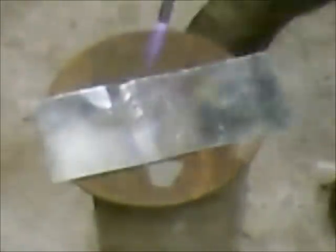We're going to heat this until it turns silver and then we're going to brush it around to tin the surface. I'm going to use a piece of drawn copper wool or steel wool.